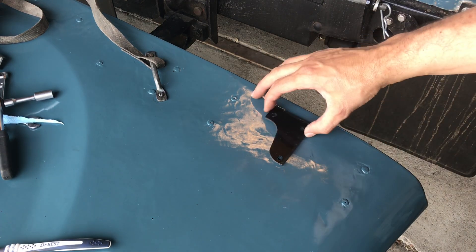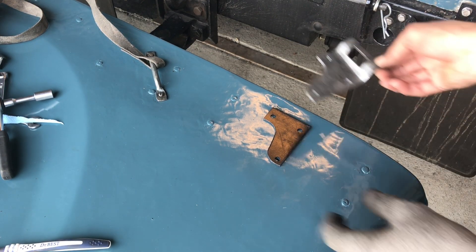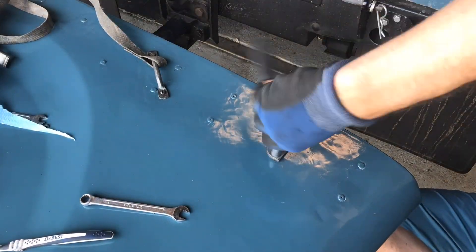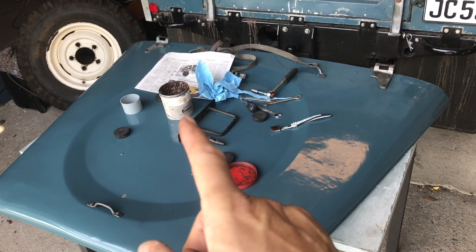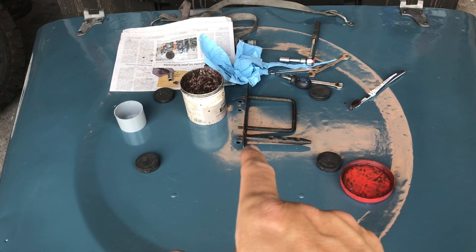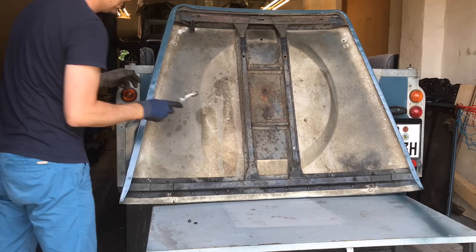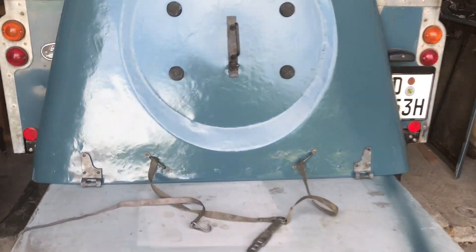You might remember me making up this plate during the week. I'm doing that because this side of the bonnet sits too high and I can't really bend it much further down without deforming the bonnet, so I'm going to try this spacer. Obviously if it doesn't work I'll take it out. That's got all the main parts on. I'm wondering actually, rather than going through all the bother of welding that bracket, I'll just put it back as it is - that'd be a darn sight quicker - and hope George still has that fitting. So that's all of the parts back onto the bonnet. I'm going to pull out the car, turn it round and get it fitted.